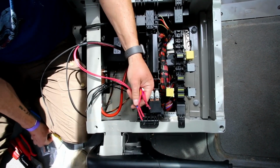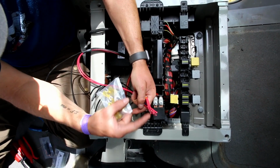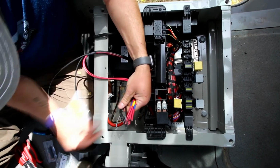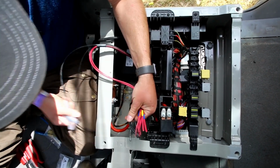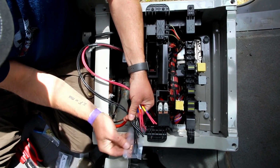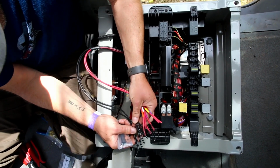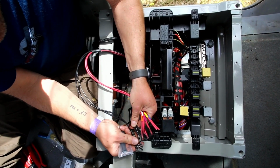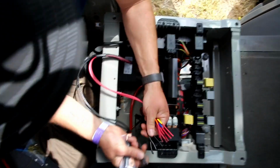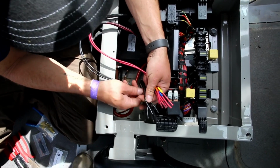But we're going to start by putting all of these little horseshoe connectors, terminal ends, to all of the red wires that we run here on our harness, and we will be gang grounding these black into these two ring terminals, and we'll create two common grounds with 3 wires into each one, and we'll put that on the OEM ground post down here.